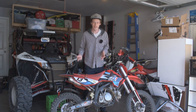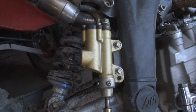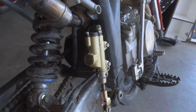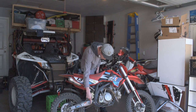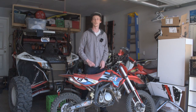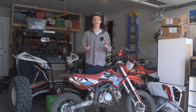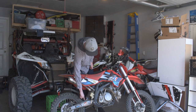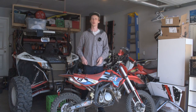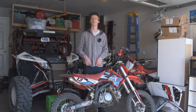The next thing broken most recently is the rear master cylinder — as you can see, this one is gold and is not the original. I blew up the rear master cylinder, no thanks to this great rear brake arm design. When the arm bends and gets contorted, it rips the throw-out arm outside the master cylinder and destroys the seals, causing all your brake fluid to leak out on the trail and leaving you with no brakes. The last thing that's broken is the rear shock mount — the bushing inside the shock at 60 hours is completely blown out, causing a massive amount of play in the rear shock.